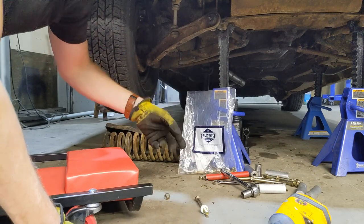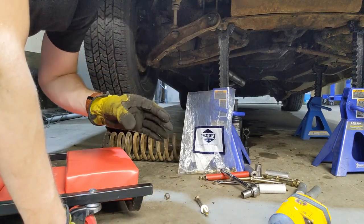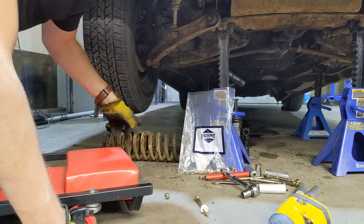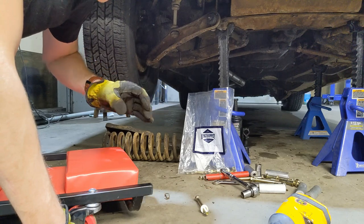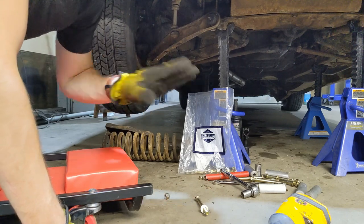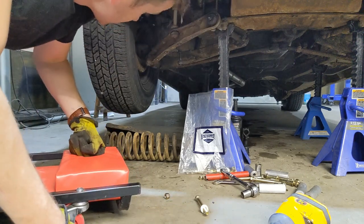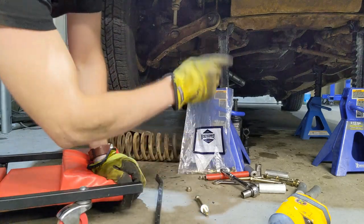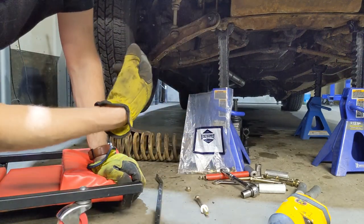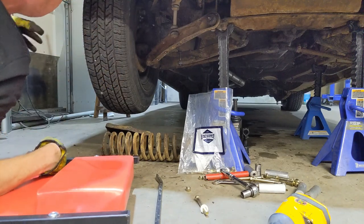So I know I need to torque these to 55 foot-pounds once I have them all in. 55 foot-pounds on 6 fasteners on this is a crazy amount of holding force. So I'm not concerned about these guys being on there whatsoever. I'm pretty confident those will be pretty strong. I have already installed the other side and I will demonstrate how I did it on this one.